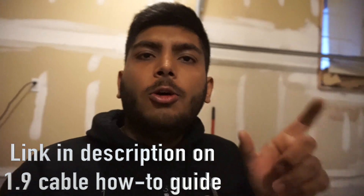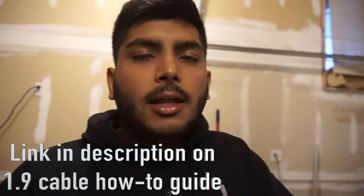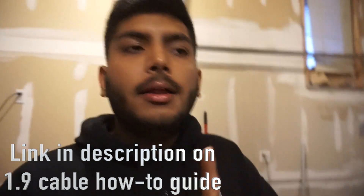What we're going to have to do is build a special cable, which we're going to show you how to do. In this case we're going to build the MEMS 1.6 cable, which uses the little round connector by the clutch master. There's also the MEMS 1.9, which looks more like an OBD2 connector and goes under the dash. They're a little different, but you can communicate with both using the Android tablet and the same app.